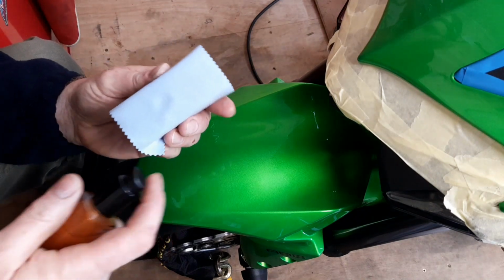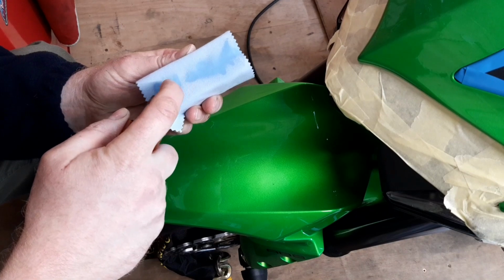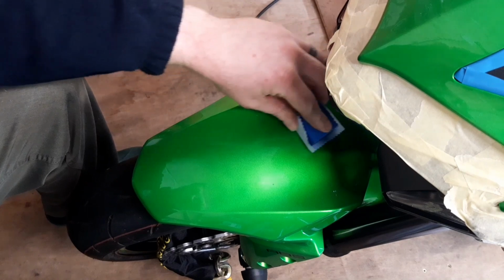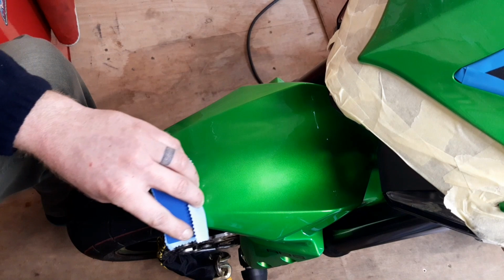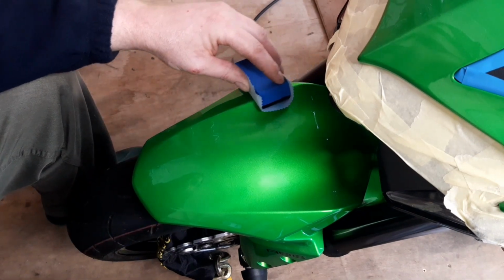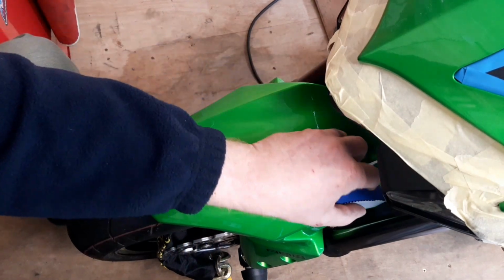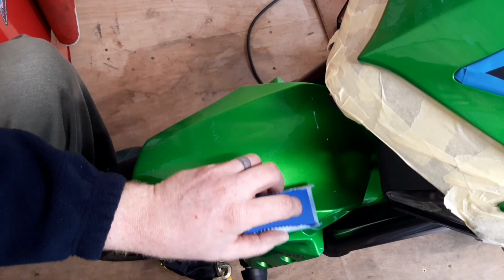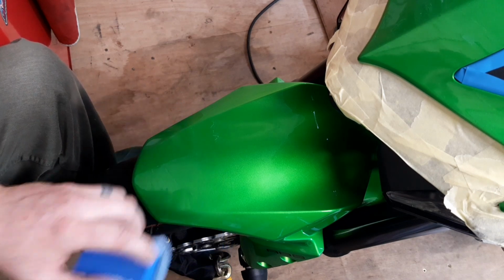So we're going to be applying the coating to this mudguard first. So we put the product onto the applicator pad. You don't need too much. And then we're just running it down the length of the panel. All these different shapes to motorcycles, you need to really break them down into smaller sections. There we go, we go left and right as well. Don't go mad with the pressure, and that wants to be left on for about 20 or 30 seconds just to flash off.